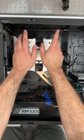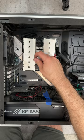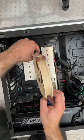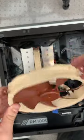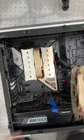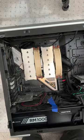With the CPU cooler smooshed into place, it's now time to put in the screws. These I remember were a pain in the butt, but luckily they don't go too bad today. Then I clip the first fan in place. For the second fan, I need to be careful with my RAM, but first I need to put the clips on it. I made several adjustments, but I have it above the RAM so it's not contacting and it still fits in the case. I plug both fans into the Y splitter and then plug that into the CPU header on the motherboard.